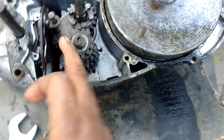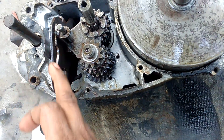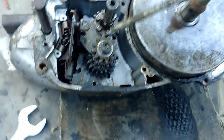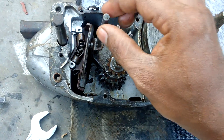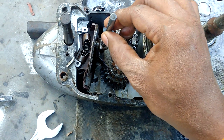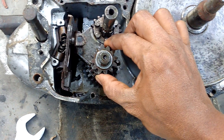the second one is on the downside. And this is the cam plate — it will change gears. First we have to remove the selector rod. In some gearboxes it won't come easily; we just have to give some pressure and pull it, and it will come out easily. This is the selector rod.